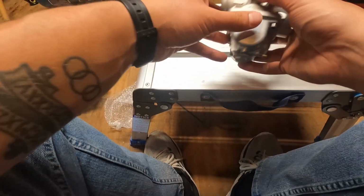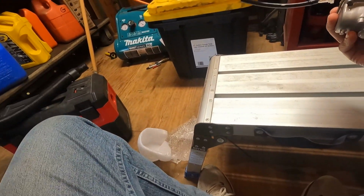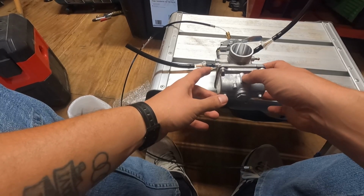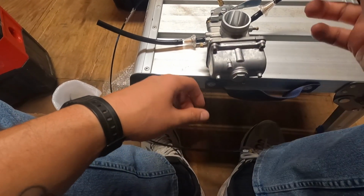Now, I think I'm gonna keep the Amals for sure, but I think I have a clogged pilot jet. So what I'm gonna do is take those off. I'm gonna drill and tap for the pilot screw access. I'm gonna source some set screws, and we're gonna do some machining on those. And I'll probably make a video of that afterwards.